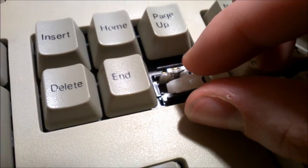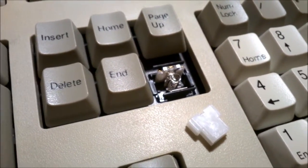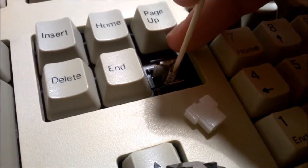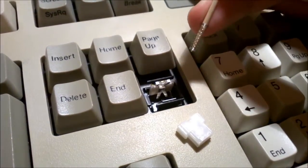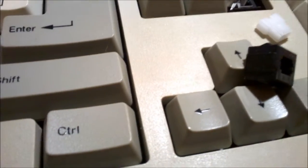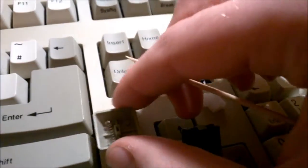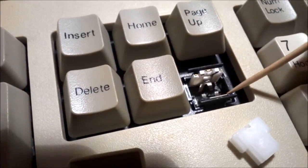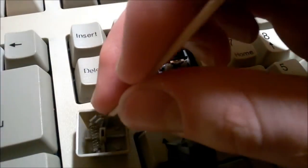So here you can see the parts. Just take the slider off — that's the spring. The easiest way to handle the spring is by using one of the toothpicks. Put it somewhere where it can't roll away, like in the keycap. And there is the click leaf here — I'll take that out as well.